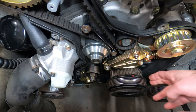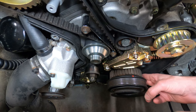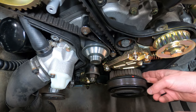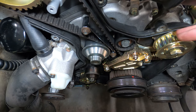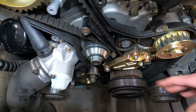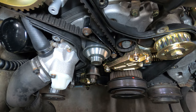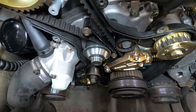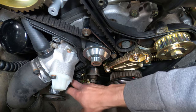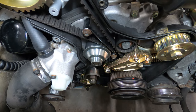Once it's in position, I like to temporarily wedge a shop towel in here so that there's pressure applying the belt into the teeth of this gear, and then we can pull the slack up and around and back down so that the alignment marks don't move as you're tensioning the roller, and that way you don't have to worry about moving it forward or back, everything's tight. And then once we get the correct tensioning value, you can just pull that rag out and lock everything down.